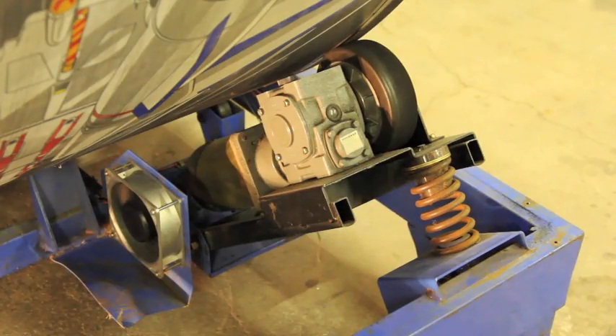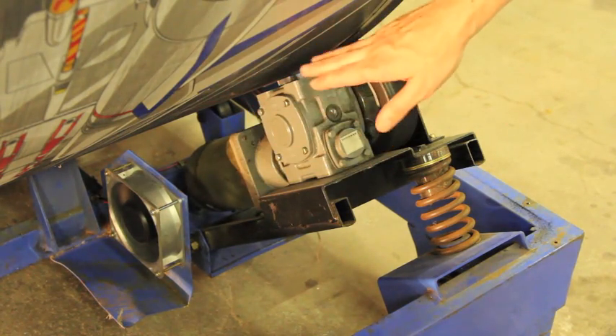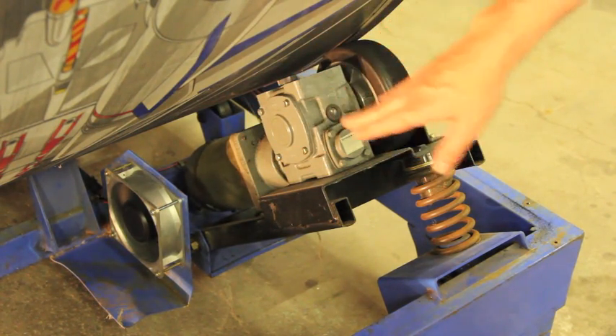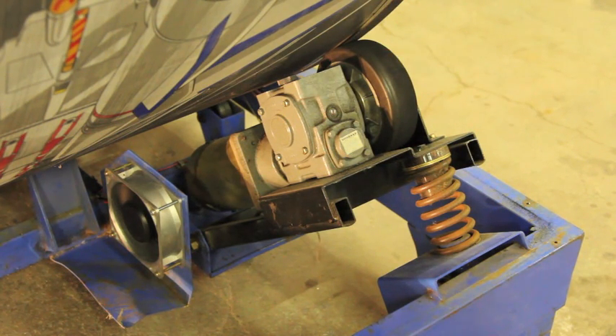Here we are at the back of the game with the cover removed for the pitch motor. This pitch motor is hooked into a gear drive box — the motor is down at the bottom, then we have a gear drive box, and it drives this rubber wheel. The rubber wheel contacts the cabinet, which is what actually makes everything move back and forth. On my cabinet somebody has put a piece of skateboard grip tape here, which seems like a pretty good idea, so I'm going to leave it. There's also a fan motor down here to help keep this cool.